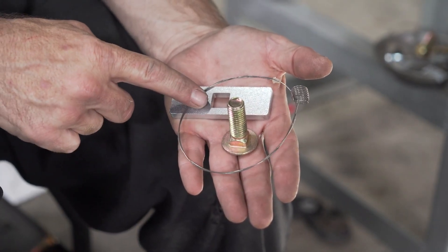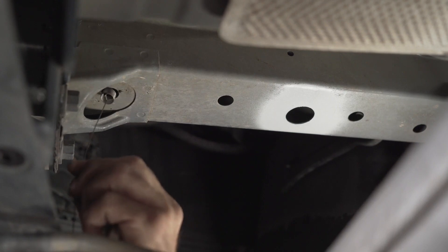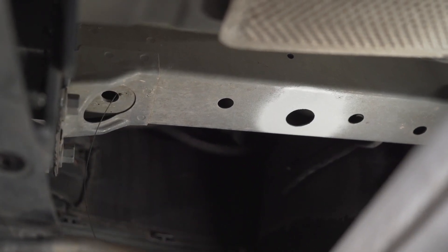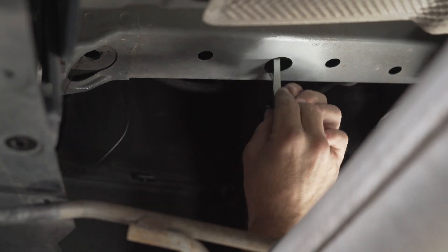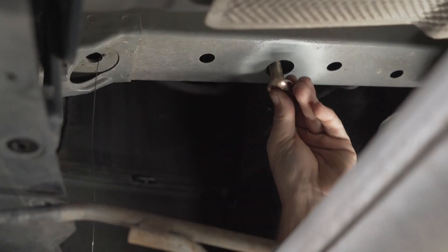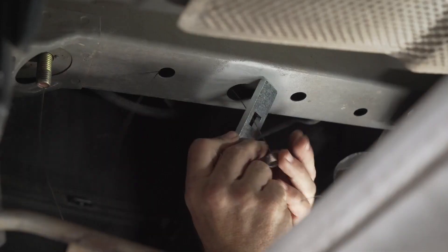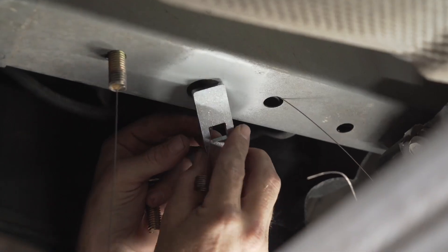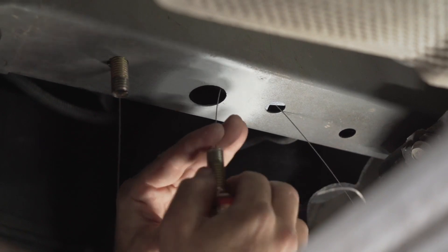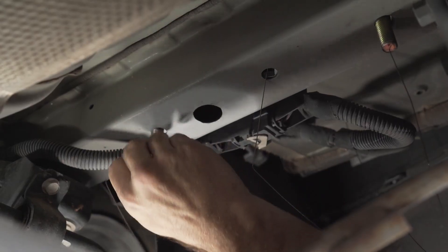We can now fish wire in our hardware. There's a half inch carriage bolt, a custom spacer, and a fish wire. Wire your rearmost access hole first. Place the fish wire into the hole and out the enlarged access hole. Be careful not to cut your finger as this edge is now sharp. Place on the custom spacer and place into the frame. Now thread on your bolt and pull the bolt through the rearmost bolt hole. We will now fish wire our center bolt hole, and then our final bolt hole which will be directly forward of the access hole. Now repeat this process for the passenger side.